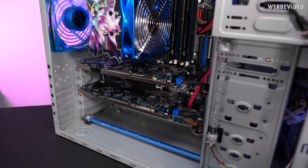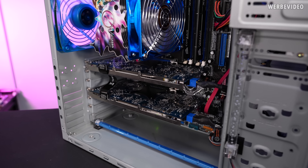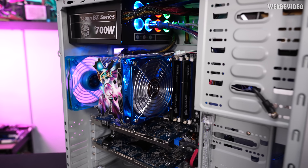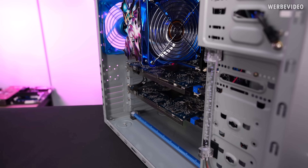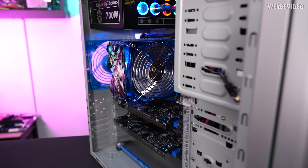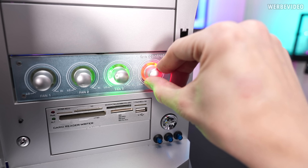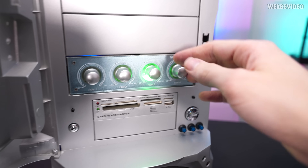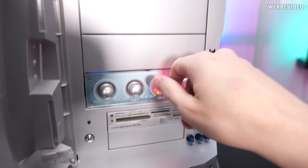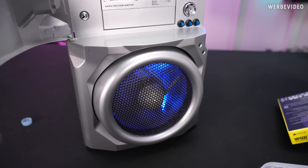The system is up and running — it's a bit loud, but as far as I remember those cards have always been quite noisy, so that's probably normal. We're also probably spoiled by today's much quieter cooling units. It could also be that it's still stuck in the BIOS F1 confirm state, which is maybe why the fans are still running at high RPM. The fan controller in front seems to be kind of broken — it's cool that turning it up changes color, but at least one channel is not working. The other channel works fine and I can spin it up to 100%, though it gets a bit more noisy.